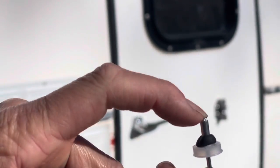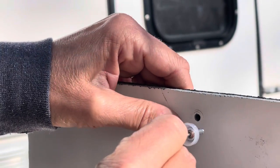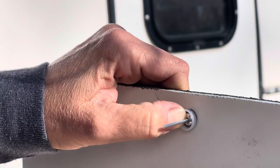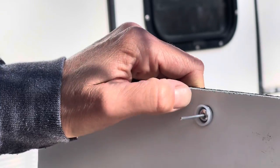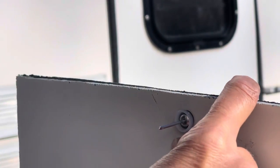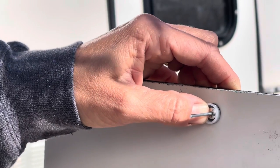I have a 5/32-inch by half-inch rivet here, and now I am putting it into the hole. This is where you're probably going to need a friend. If this application needs an acorn nut on the inside — say it's holding a cabinet on the inside of your Scamp — you'll need someone to hold it on the inside. If it's holding a bracket for your curtains, you'll still need someone to hold that bracket up while you do this.